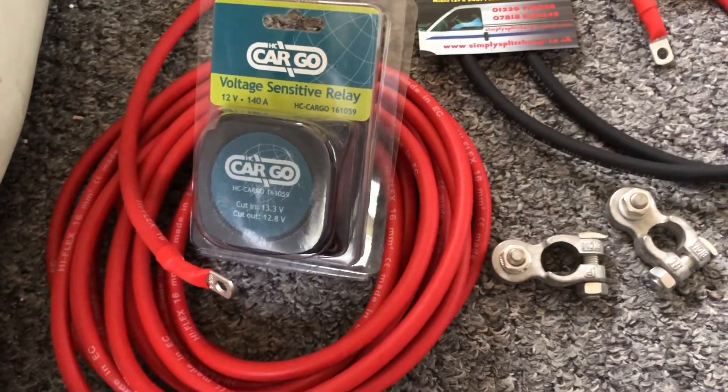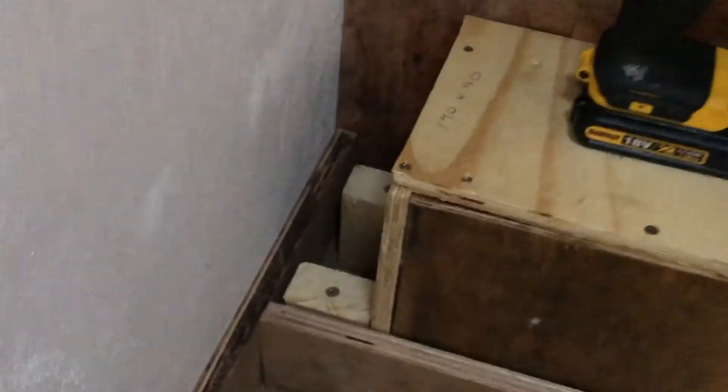At the minute there's a wire for the reverse camera, and it will also need to cater for the split charge relay wire and any other appliances I want to add on that side of the van. I used the angle setting of the saw for the first time — the first couple of cuts went okay but I pretty much mullered it trying to make it fit a little nicer. I ended up just attaching it to the van anyway, managed to fit it in, screwed it at either end, and now I have a wire tunnel that I will waterproof from the shower. The last part was a tiny piece in the corner not covered by the shower tray — I chopped a couple of bits of CLS, screwed them to the floor, and chopped a bit of 12mm ply to level out that corner.